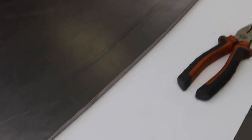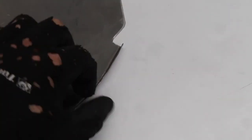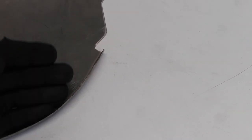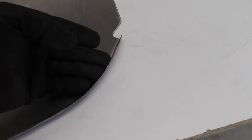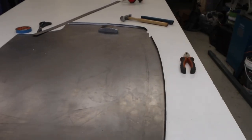I am really happy with this edge — it's come around nicely. I haven't folded it all the way up to 90 degrees, mostly because the repro panel doesn't either, and it gives me a little bit of room to make sure it all fits nicely when it gets into the car. That is looking really good. I'm really happy with how these corners turned out. There are a couple of little pinches and wavy spots where this has extra metal that wants to turn around the corners, and I just managed to tap it out using the edge of the dolly and get them nice and straight. They shrunk nicely and it's looking really, really good.